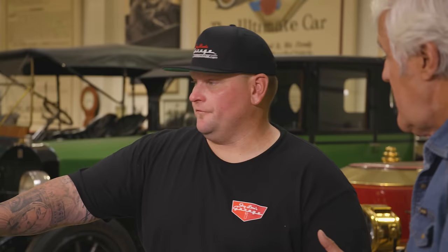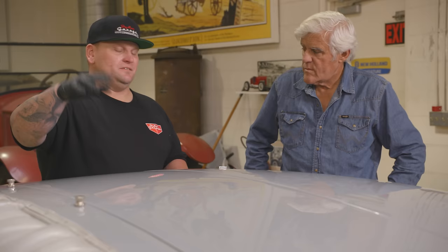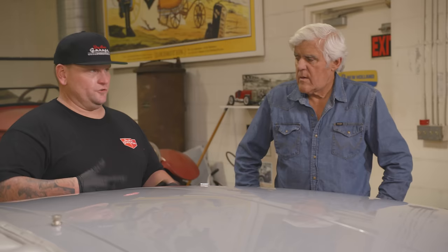The first step was taking it outside in the wash bay and cleaning all the dirt and soot off. Being worked on, you've got pieces of metal, dust, everything you don't want on a painted surface — because if you just take a rag and spray product and wipe it, the potential for scratching is high. So we cleaned the surface, then brought out our polish. We only needed one step — our softest polishing pad and least aggressive polish — just minor light scratches, and they came out quick. It looks like a mirror now, coming out beautifully.